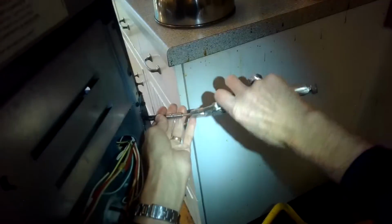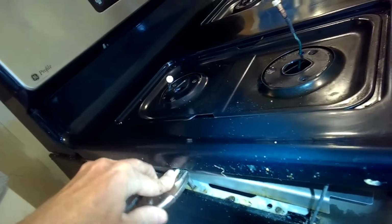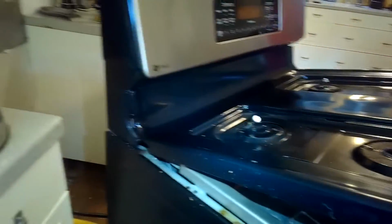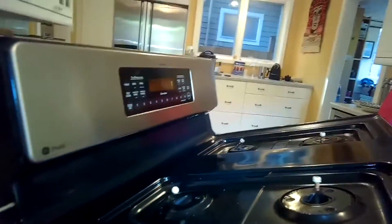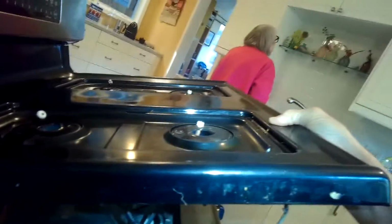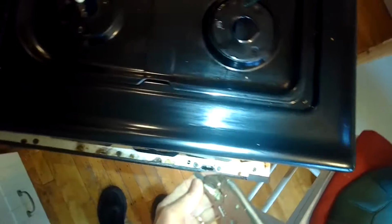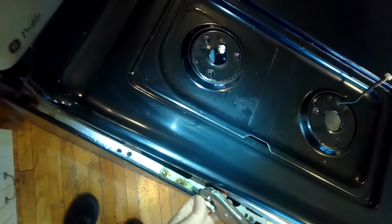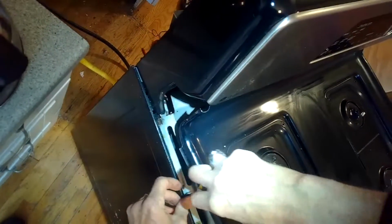and also the fan. Now these are a couple of 1/4-inch screws on the side that we're gonna remove in the back, and these are Phillips head screws we're removing from the top. Again, this is the left side as viewed from the front. So if you get those screws off, then you can take off this side panel, and that'll give you a better view of what's happening with the wires inside.